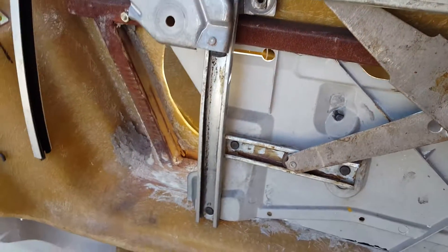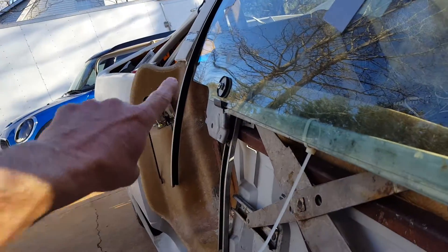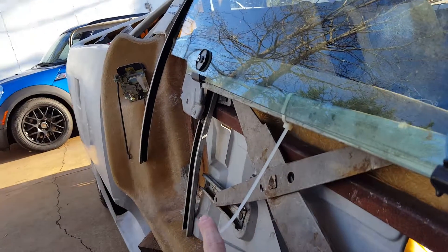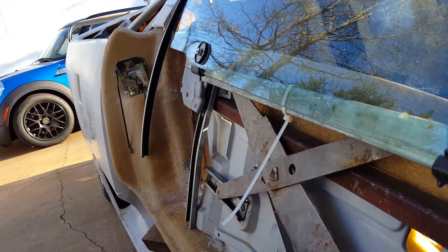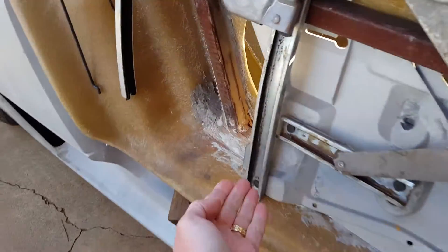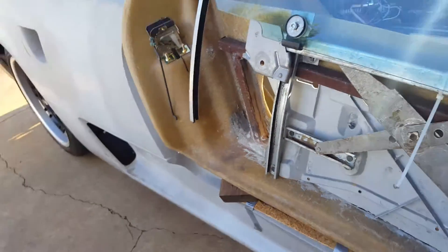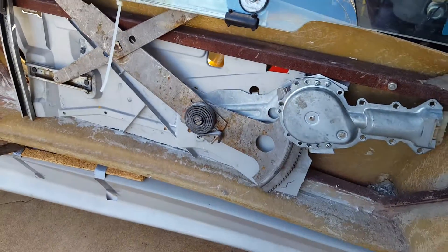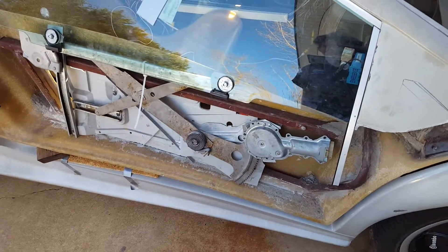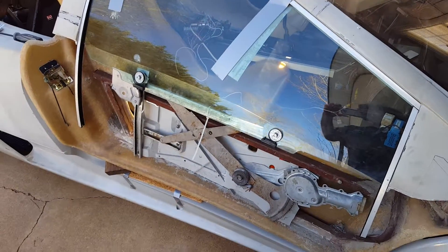I'll be able to get this thing in here at the right angle. Looking down through here, you can see the angle of the glass coming down and the angle of this — this actually does have a radius in it. But that bottom is probably out too far; I'll probably get this bottom rail in more. I'll probably even cut away more off the bottom of that so it can go in more. Anyhow, you can see what it takes to get one of these regulators in one of these doors. Thanks for watching — that will be the update for this turn.